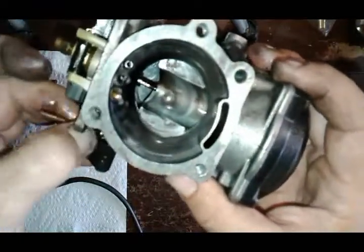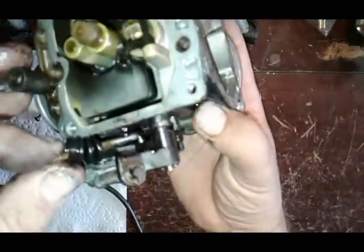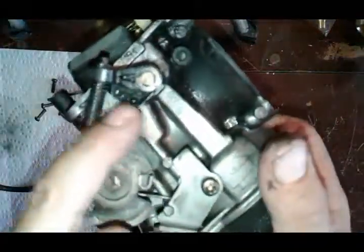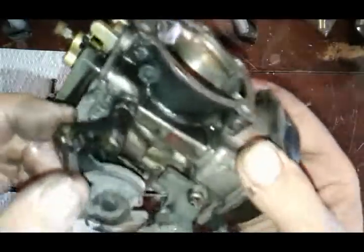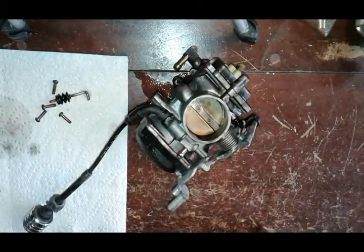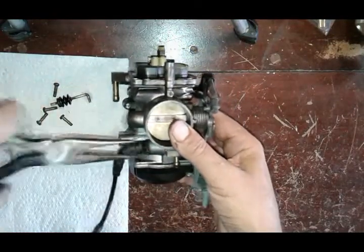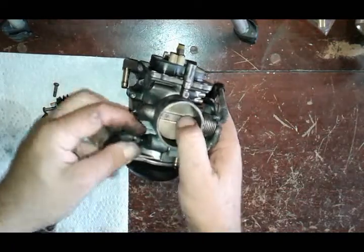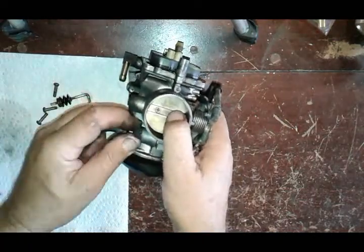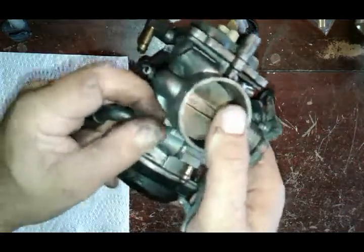It's got this little boot — sometimes it stays on the carburetor, sometimes not — but you just pull that off and put it aside. It's got a hole right here and fits in from the back side, so you can't really mess that up putting it back together. Next I'm gonna take my choke cable off because it's in my way and I need to replace it anyway. Needle nose pliers are enough to crack this little plastic nut loose — you can pull on it to release the boot and the whole assembly will come out.